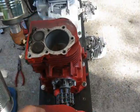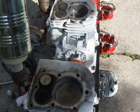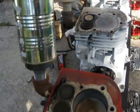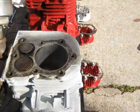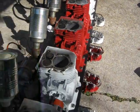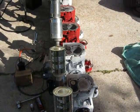On this type of crankshaft, 1 and 2 are opposites, as are 7 and 8, and then at 90 degrees all 4 mid cylinders are at the mid position. If I flip her over to a 90-degree crank position on number 1, then number 3 is at the top, 4 is at the bottom, 5 is at the bottom, 6 is at the top, and the last 2 are at the 90-degree position again. Looks like I've got her phased right, which is a good thing — that means I stand a chance of having it run correctly.